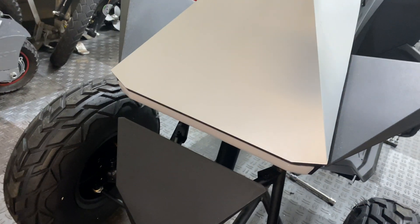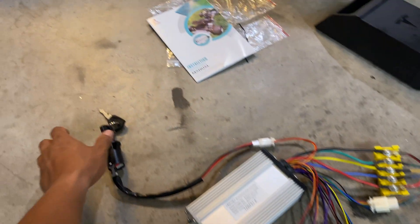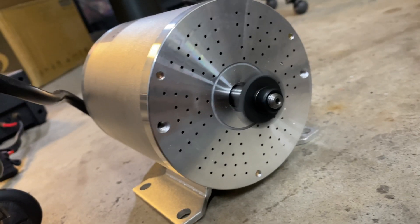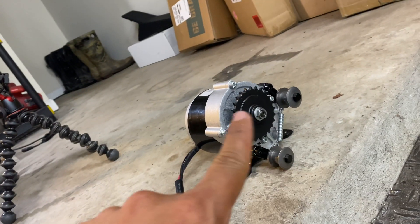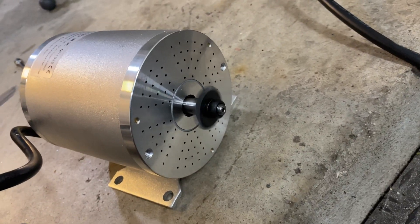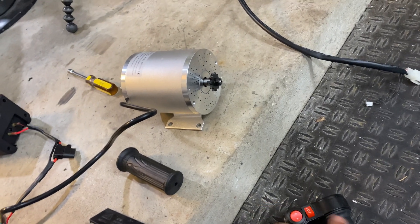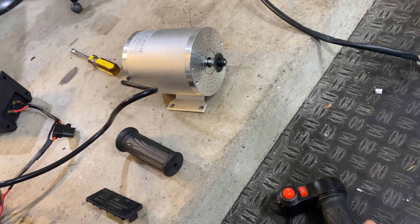The Tesla Quad has factory LED headlights and a tail lamp set, so I might make the indicator light wire work with those — I'm going to test if it puts out 12 volts. As you can see when turned on, the motor spins clockwise, not counterclockwise like it's supposed to. If I go in reverse it spins counterclockwise, but not as fast — you can hear it. Even on a faster speed setting in reverse mode, the speed is limited. So we're going to have to figure something out, potentially swapping wiring to reverse the polarity to make it spin the other way.